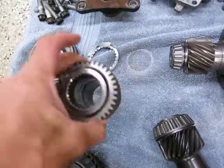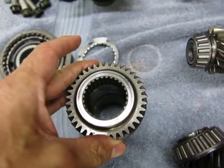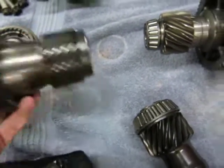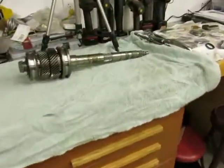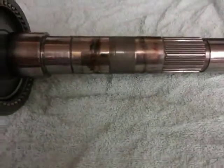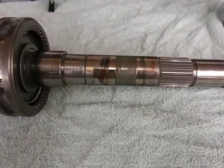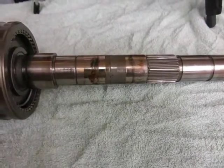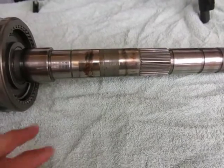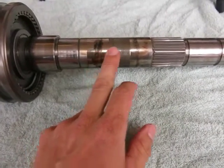As you can see, it's very clean. Inside is very clean. The splines look good — there's no teeth worn into them or anything like that, as can happen when they get worn. But unfortunately, it came off by hand. It's supposed to really be pressed on there, and when it's loose on the shaft it can cause a vibration when you're in 5th or 6th gear. You can see there are actually some markings here from where it must have been wiggling around just enough.